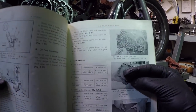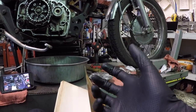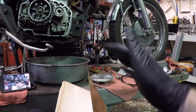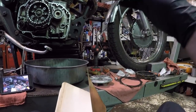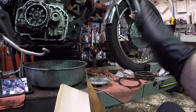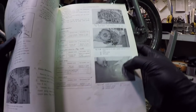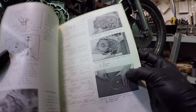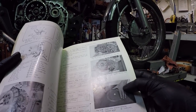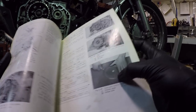They may be, but the way that they were sticking together and not unlocking when I pulled the clutch all the way in, I don't care. I'm replacing it because I know that was the problem. I mean, that clutch sat engaged for almost 30 years, okay? This is a good measurement to take if you may want to save money and not replace the metal discs. I always replace them, so I always recommend replacing them. I never will tell you not to replace them, but this is a check that you can do on a